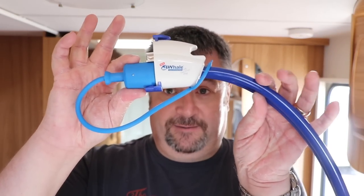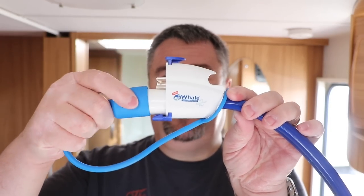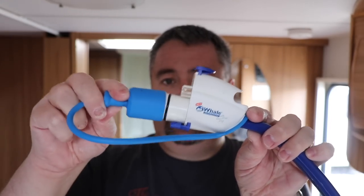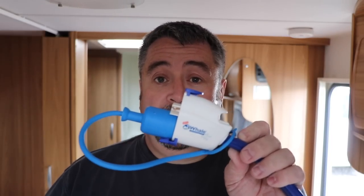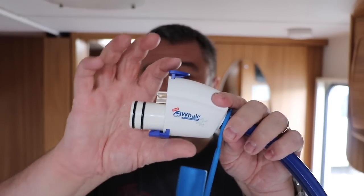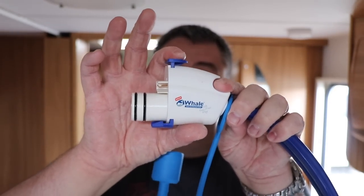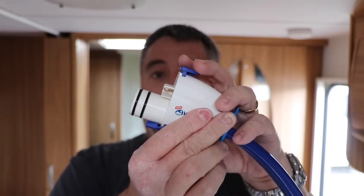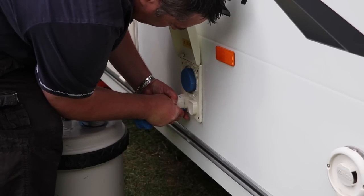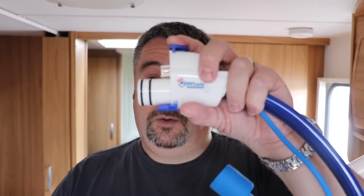Let's start with the plug that fits into the caravan. As you can see, you've got a little protective cover here, which protects these O-rings and keeps the end clean. It also means that when you're finished with the caravan and you take this pipe off, you're not going to dribble everywhere when you put it in storage. Another great benefit is that the plug has a solid positive catch at the top — press that down, insert it, and it locks in place. When it's time to remove, press down and pull out. The Truma system just felt a little bit plasticky and you always felt as if you were about to break something — there was no positive catch on that system.